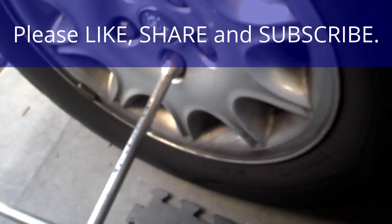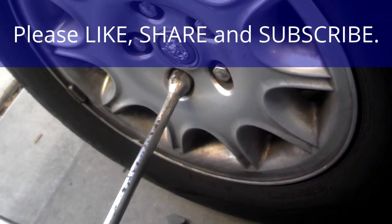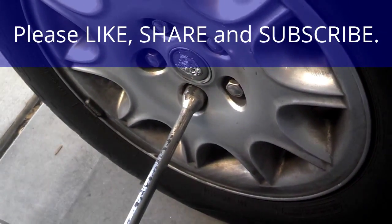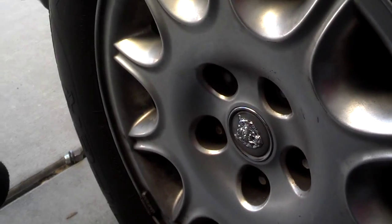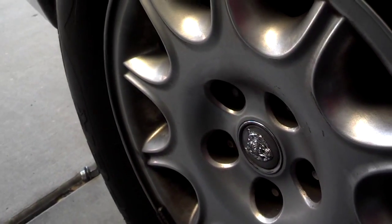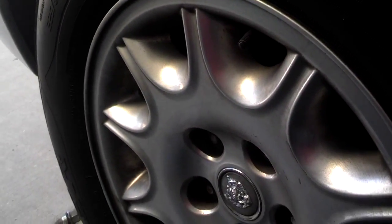Okay, I jacked it up so the wheel is off the ground. I don't get it too high, maybe about 5 cranks past up. Now I'm going to go ahead and pull the lug nuts off the wheel and remove the wheel. Once all the lugs are off, you want to bump the wheel at the top, and that should break it free from the hub.